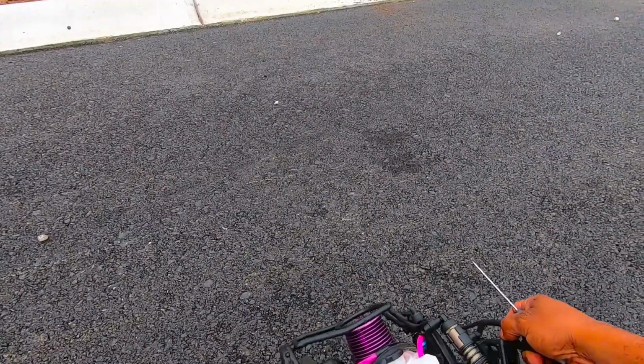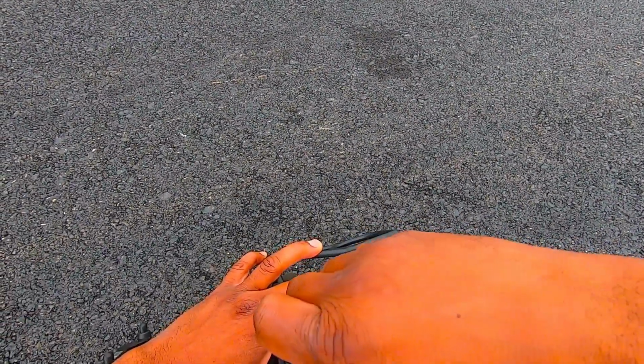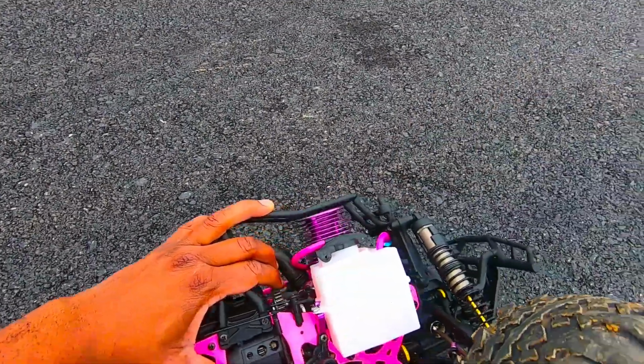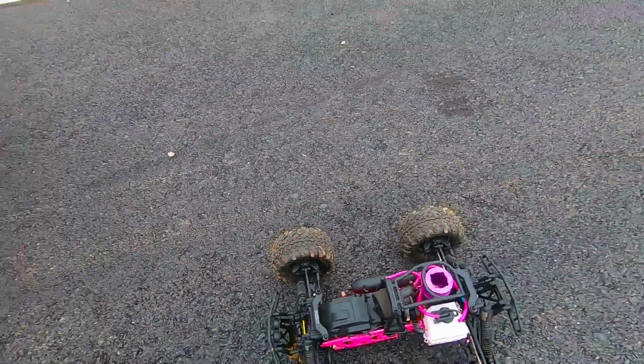So car off, since I need to move that back. Take that out. Rotate your spur until you see that opening there, and then you rotate your wheel till you see the bottom screw. Alright, so I'm gonna go all the way flush to the edge. With these 3 speeds, the manual says it should be 5 turns in from flush. So 1, 2, 3, 4, 5, right? So that's base setting for 3 speed. Now that setting is for the XL, you know, the weight matters and the big wheels, so this may shift still too early. But let's see.